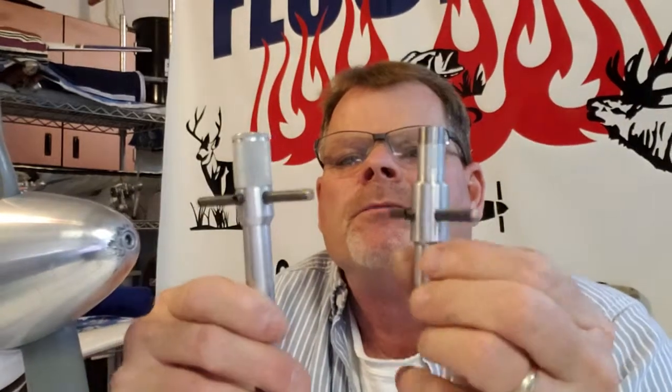And this, I wouldn't crank super hard. You can't crank super tight with this type of setup. You just can't. There's no T-bar coming out to really get leverage and crank it. But when I come down, man, those plugs, the heat, they would get in there tight. So this right here in the 3/8 end is going to allow me to really bust open and free up those glow plugs easier. So I went ahead and ordered 2.